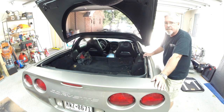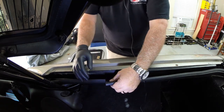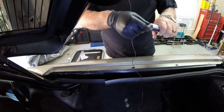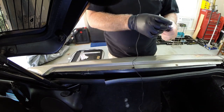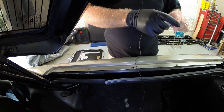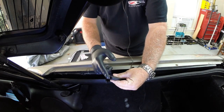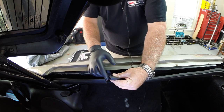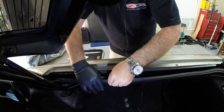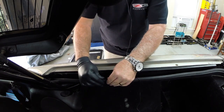This is where the gap is that we're going to seal up. I went ahead and put a rubber glove on because we're using this stuff and it's going to be a little bit of a mess. I've got the Permatex Ultra Black — I'm using black because it matches the color of the seal, really no other rhyme or reason. It doesn't make a whole lot of difference but I wouldn't use some bright color if you're doing this. I'm just doing a little bit of a dab on the ends of the seal, then kind of stretching it back and pushing it back in place, squishing it together so that we get the best contact we can.